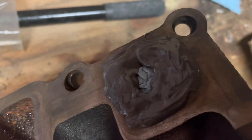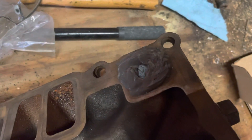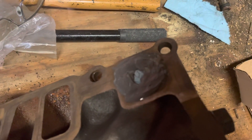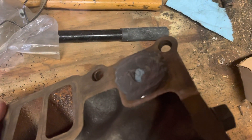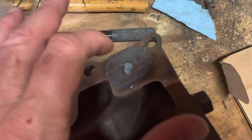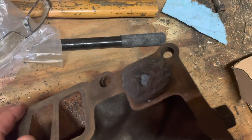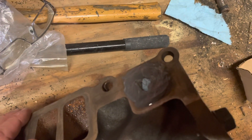And then I'm going to come back and sand it smooth. You can use a flat disc or something similar to get it almost down to the bare metal. You've got to be careful that you don't gouge the metal. Get that surface down and then finish up with finer and finer sandpaper to get the repair surface even and flush with the face. Then you trace out the intake gasket hole and grind away to the inside edge of the hole. And that's how I repair intake passages.